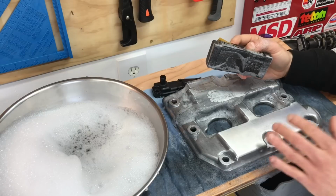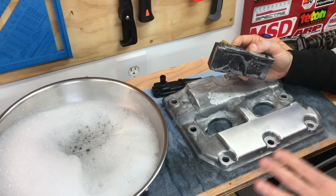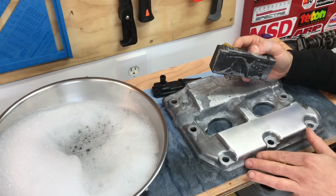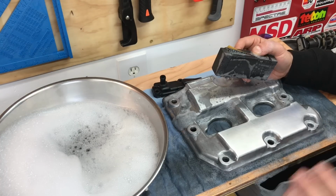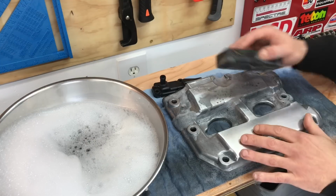I'll also mention that the most effort is probably going to be with that 600 grit sandpaper because we're taking away the most material with that 600 grit sandpaper. We're going to take down all the oxidation and all the staining from this aluminum surface with that 600 grit sandpaper. And then the 800 grit, the 1500 grit, and the 2000 grit sandpapers will go really quickly and prep this metal surface for the final polishing step.